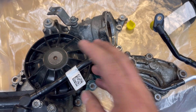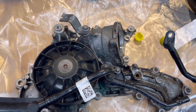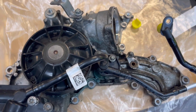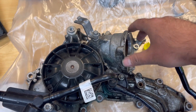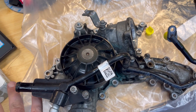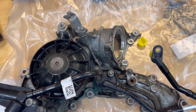Plastic gives you the best of both worlds — you can't use rubber, you can't use metal, so plastic is a happy middle ground. The problem is that after accumulating miles, especially in a hot climate with frequent hot-to-cold cycles, the plastic becomes very brittle and easy to crack. Anytime you're working in the area you can touch these hoses and crack them, so always have them on hand when doing thermostat, water pump, or any related work. The other side will never go bad — it's crimped and very strong.